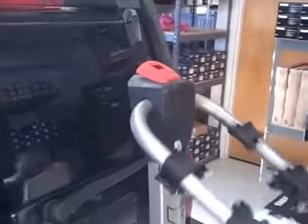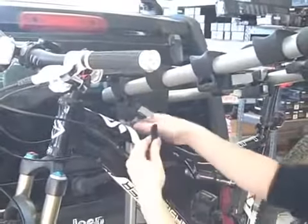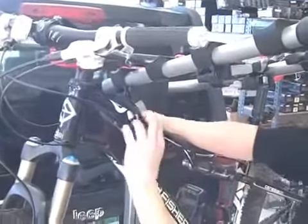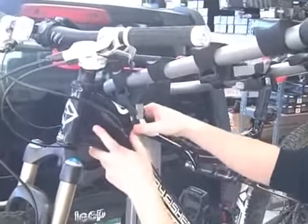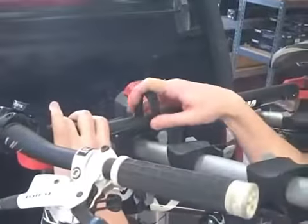The red lever on the top of the rack gives the bike arms the ability to fold up and down, shrinking the rack's profile when not in use. Bikes mount to the Swing Daddy using a series of plastic ratcheting straps. These straps give you good tension without stretching and are padded so they don't scratch your frame. Each mounting position has three padded cradles: two for your top tube to hold the bike up, and one anti-sway cradle to keep bikes from bumping into each other. To unload the bike, the straps are removed by pinching the gray ratcheting tabs.